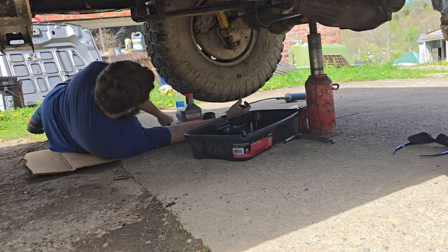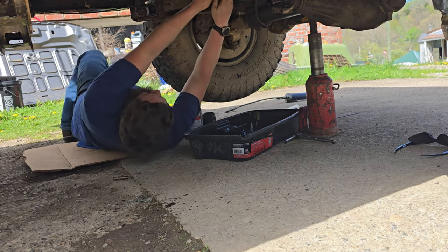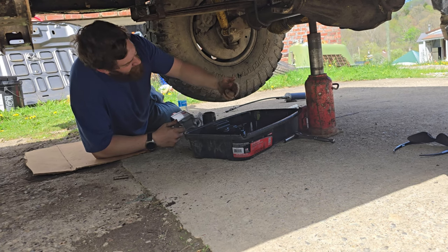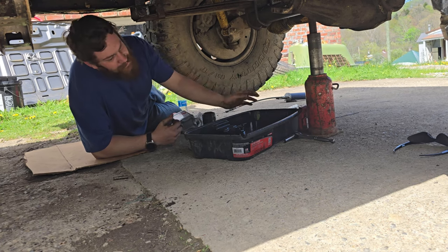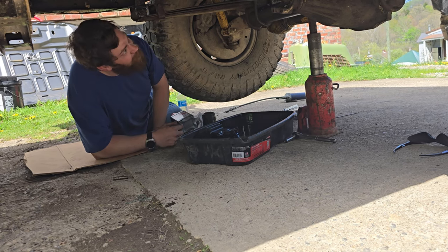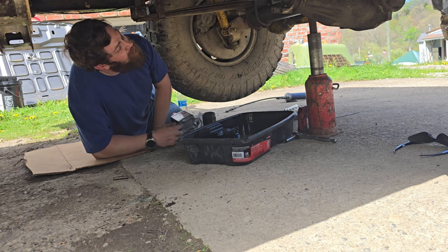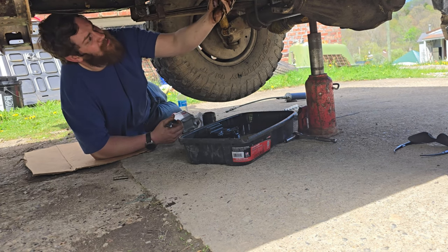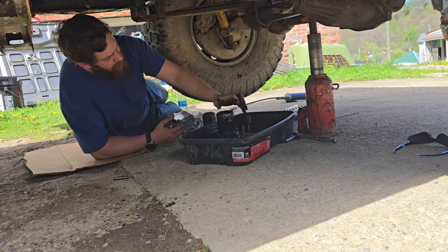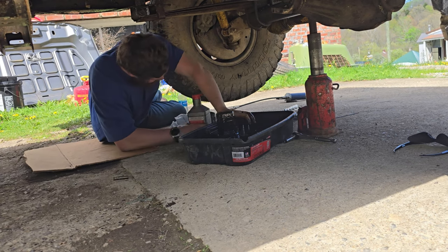The filter is brown — that's not good either. We're going to revisit this. I'm probably going to throw an extra couple of filters on — maybe a filter every 500 miles, we'll see. I didn't lose any oil pressure though — I had awesome oil pressure. We've got to bring as much of that nasty stuff out of there as we can.